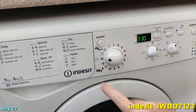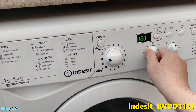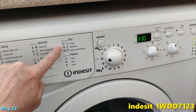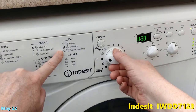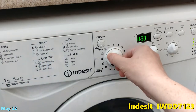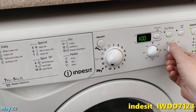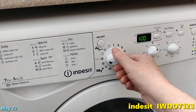The quick wash one seems to be number 13 — express wash and dry — which takes 30 minutes and can only be done at 30 degrees. The dryer on its own is number 11 and 12: 11 is cotton, 12 is synthetics. With the dryer set to zero, it's one hour 60 minutes if you just want to use the dryer on its own.